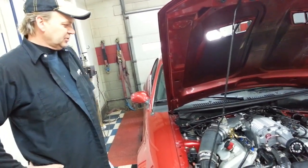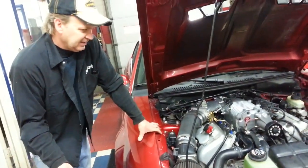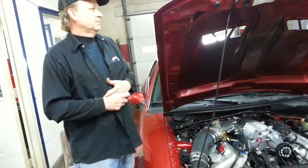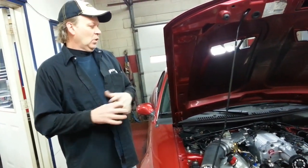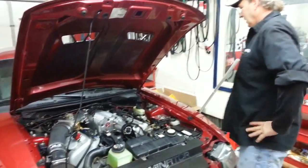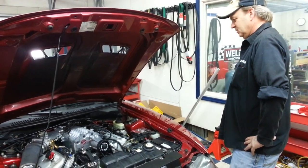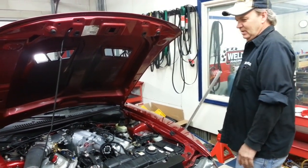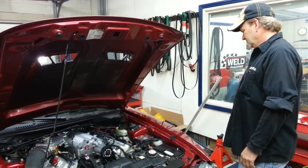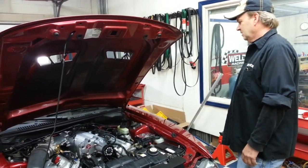We do like to use a Metco-style cold air intake, and on the oil, you should thicken it up. Run some 5W-40 or 10W-40 with a high-performance oil filter. Other than that, I'm trying to think if there's anything else we missed. We do like to delete the thermostat or put a 170 in and turn the fan switches down. And you like to have a hell of a clutch to hold it. Always make sure there's a little free play in there.